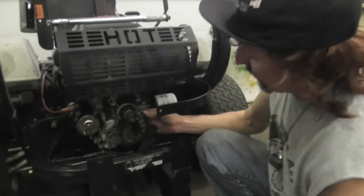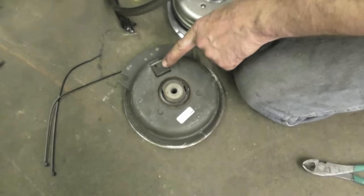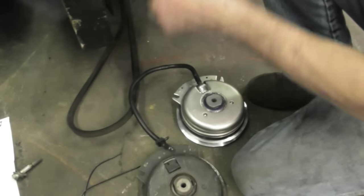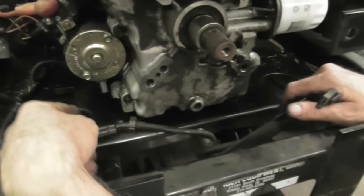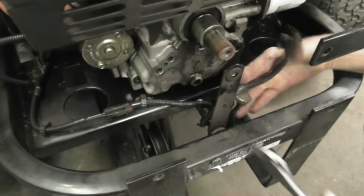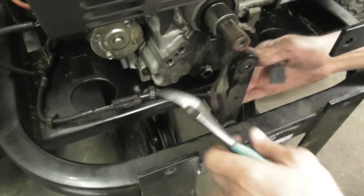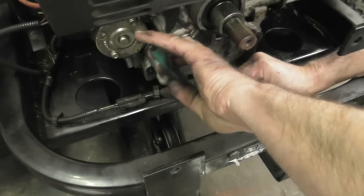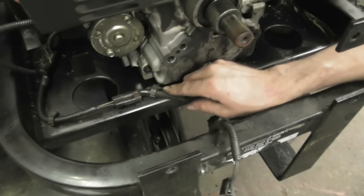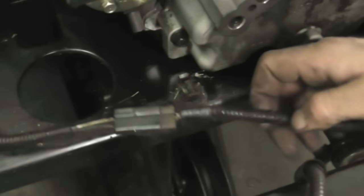So we're just going to go ahead and install the clutch on this here Xmark. Okay, the old clutch, the connector plugged into the back of the clutch. This new Xtreme clutch comes with a long whip. And you can see that this one is all wrapped around and it goes to a connector here. That's where we're going to connect a new one. So I'm going to go ahead and cut these zip ties off this anti-rotation device. And we can just unplug this.